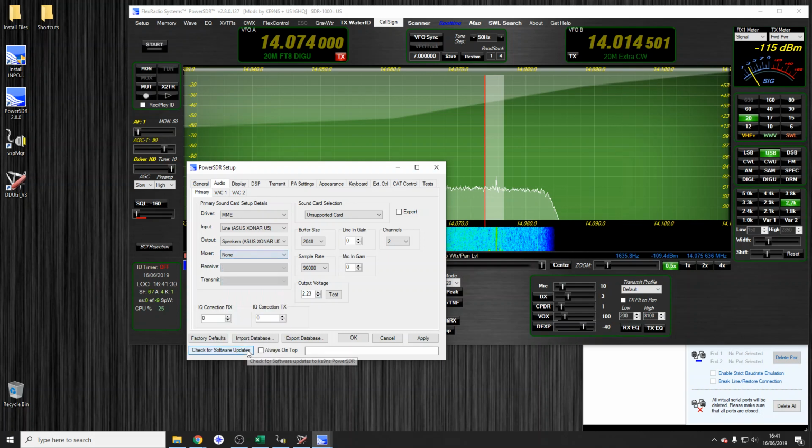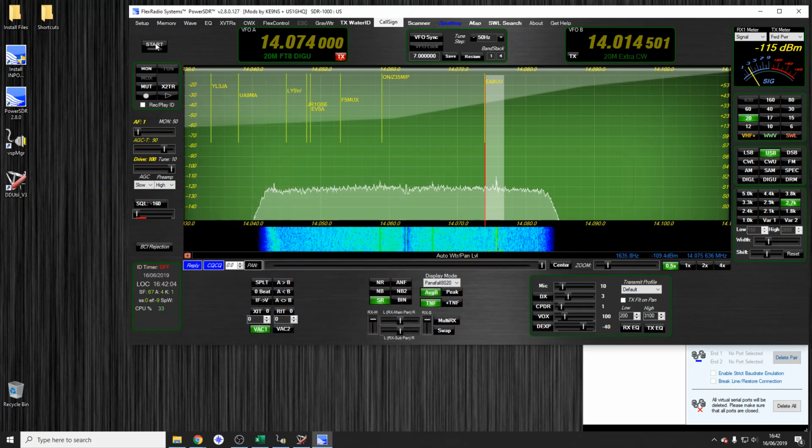Mixer, I'm going to select none, and crucially I'm going to now select my sampling rate, and I'm going to leave it at 96,000 there, 96 kilohertz. Leave that set at 96. The line in and the mic gain you can adjust. This is all about getting the levels correct. Certainly further videos required on this, but you can leave those default for now. And click apply and click OK. I'm going to start that.